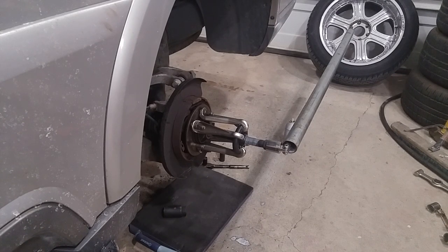I had to re-thread the axle with the bolt by using that long pipe you can see on the breaker bar as an extension for more leverage. It was murder getting the bolt off, but it re-threaded the end of the axle and I was able to bolt it back up. I went to a few different mechanics who all gave me the same warning — they may have to destroy the axle to get it out, because the hub can mechanically weld to the shaft just from the force over the years. This truck has 180,000 miles on it.